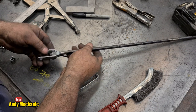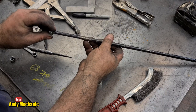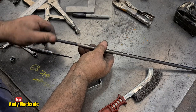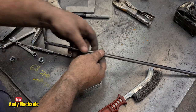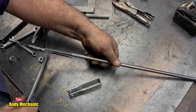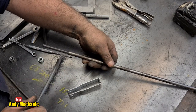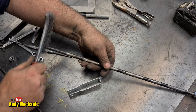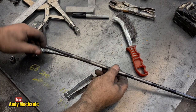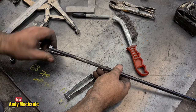Okay, I'll leave it loose for now because it's going to need some adjustment. Now, another normal nut. My apologies if it's not focused. In fact, let's just clean those threads out as well because these haven't been cleaned out. You always get little bits of swarf in everything, so it's a good idea to just clean it all out. Here we go. Quite enjoying this now. At the start, I was like, oh, really? Another job to do?